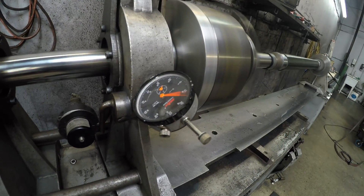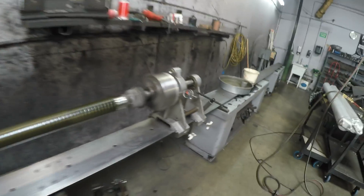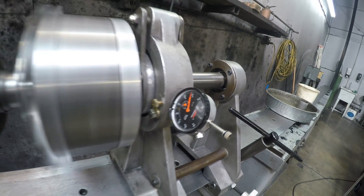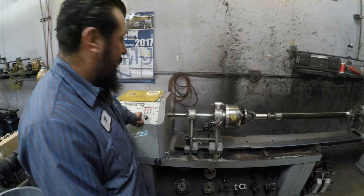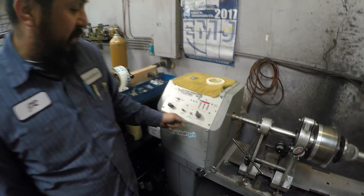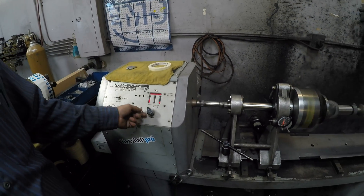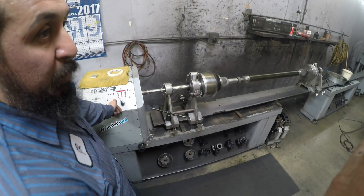This is the rear, so it's off about 5 thousandths, and the front — the 20 side — probably about 1. We're going to leave the front alone, do the rear, see how much it changes, and then give it all the speed we got. The light turns on — that indicates that the balancer already set its point — so then we go counterclockwise so it can look at that point too, and then that's where we put our weight.